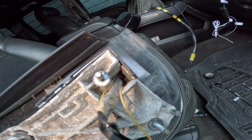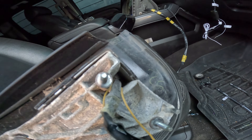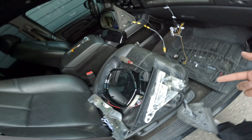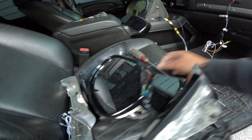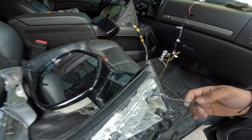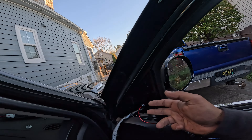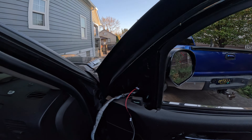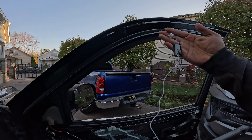You see where that string is — it's hugging that black connector, and that's the connector for this. I took the red and black cable all the way in but there's a 90-degree turn, so I got a string and pulled it through. Just be prepared for the wiring — I got the connector out with the string. Once you pull it out you're all set. Flip it around, put the cap on, and once the wire is through, everything clips in. Once you mount them make sure you fish in the cables, bolt them down, then put the insulation back so water doesn't get through. From there you wire from the inside using the quick disconnect.